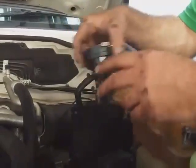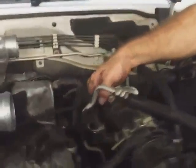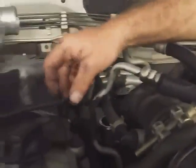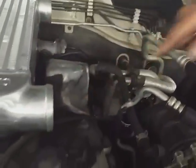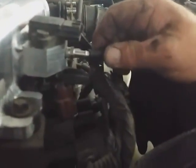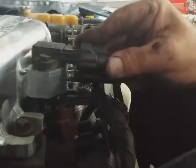Once that's installed, the kit also comes with a silicon line. You just run your silicon line directly out of the actuator to the intercooler — whether it's a monster intercooler like this DieselSmart one or just a factory one. Run it to your boost reference, pushing that on like so. Put a zip tie on both ends so they can never come off. And that's it — it's fitted, done.